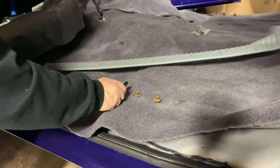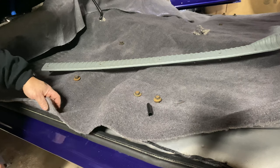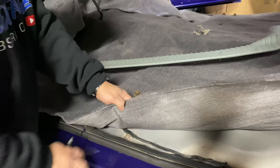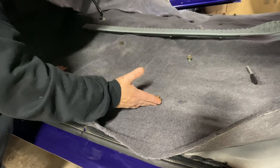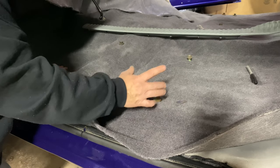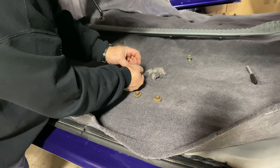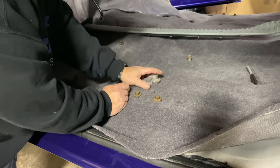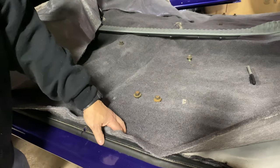I'll put my trim molding here to actually see how far out where my trim molding goes, so I know how far out to go with the carpet before I start trimming the sides. I like to go to where the holes are that fasten your trim down or your fasteners and just put my finger there. Then underneath I'll get my sharpie — I don't make marks from the top — and put a little mark there. When I look at it, the carpet actually goes underneath my gasket, and then the trim comes up over the top like it's supposed to. Remember, if you make any mistakes around the bolt holes, the seat footprint will cover them.